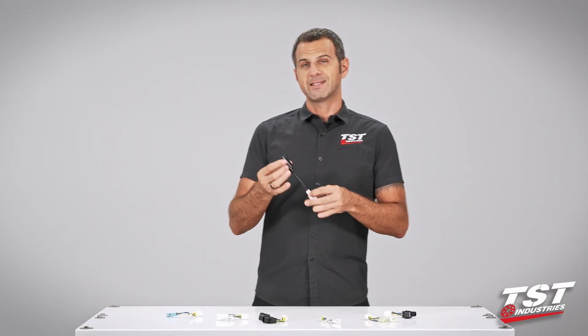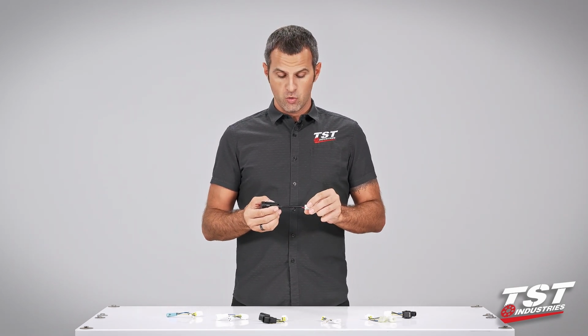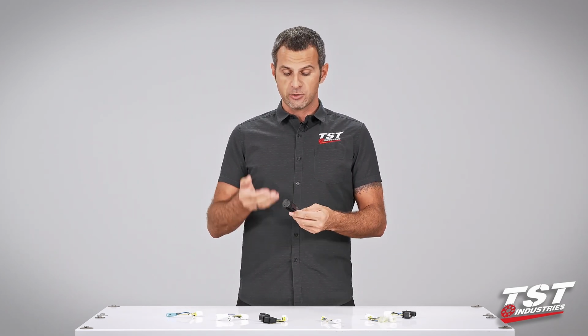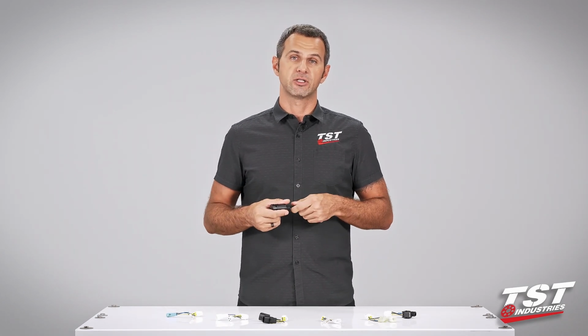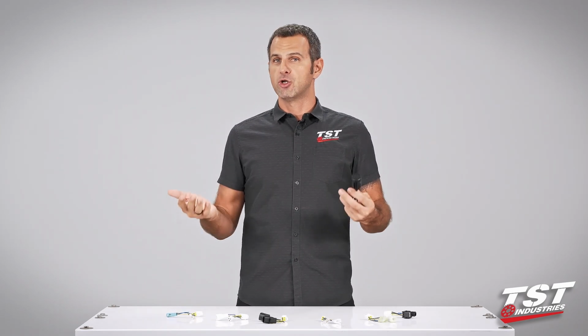We did think about the safety of such devices during the design phase. So we decided to design this in a way that it will be a pass-through component. In case you experience a failure on board here, it will just pass through your normal brake function, which means you press your brake, the light lights up, there's just no effect.